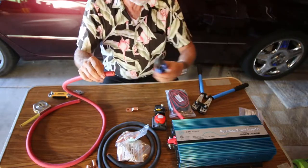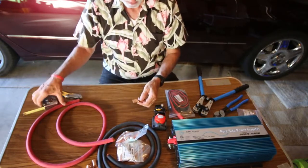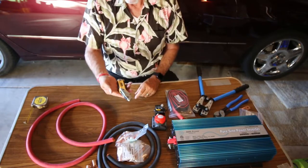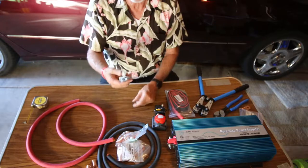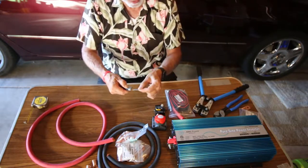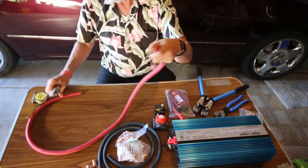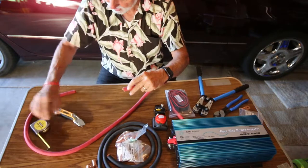For around $30 I got an affordable crimper and cutter. I'm not going to have to cut this first one because it's a pretty good cut. What I'm going to do is put on one of these connectors — I have to peel back the insulation. For this four-aught cable connector it's about three-quarters to seven-eighths of an inch. I'm going to go for three-quarters of insulation. I've got a DeWalt cutting tool here, and to put a blade in, I had to find a YouTube video — the instructions just didn't give me enough information. You have to have it fully out there, push the button on the side, and then it will release.